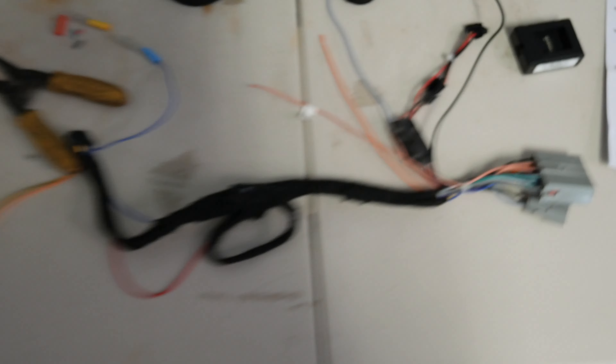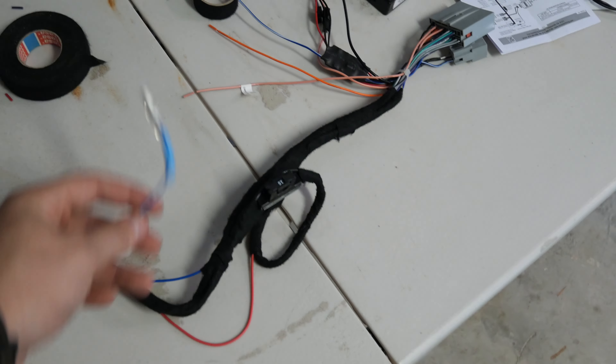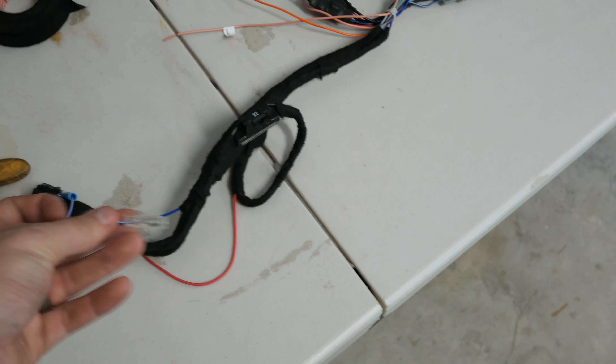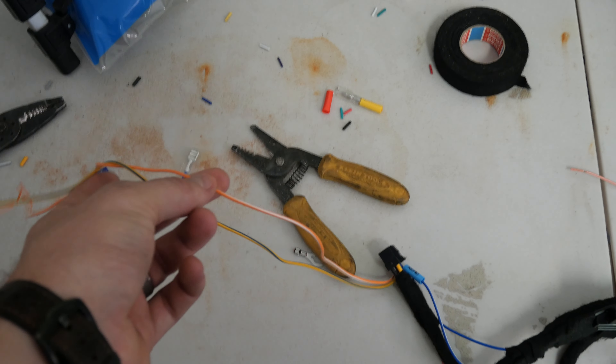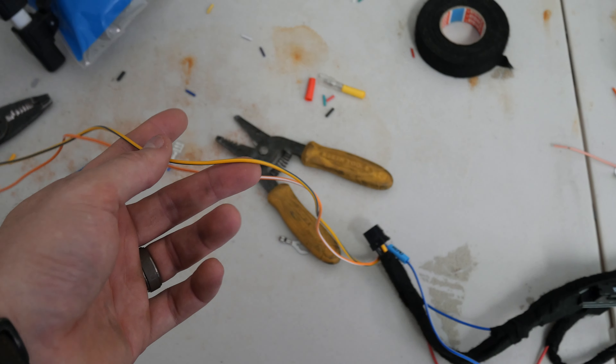Really, all I have done — I have all the wires connected with the power wire and everything in here. This is for connecting from the head unit to the amplifier I'm going to be putting in, so this I do need. I'm going to tuck it away until I have the amplifier, and I'll pull the dash back out and connect that. Orange is your reverse lights to kick on your backup camera, and yellow is your parking brake wire that you have to connect to be able to get into some of the advanced settings and setup features on the Alpine. So we're going to hop in the truck, pull the dash apart, get the factory radio out, put in the dash kit, and then start plug-and-playing all the harnesses.